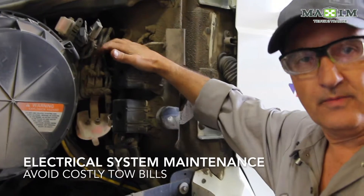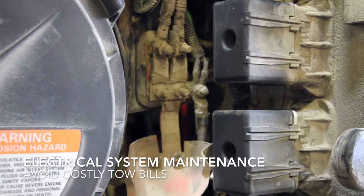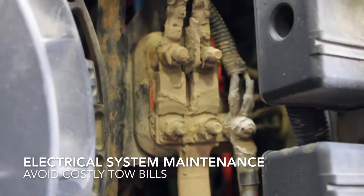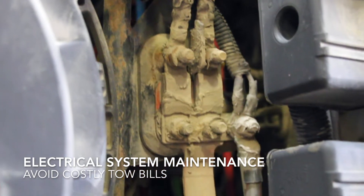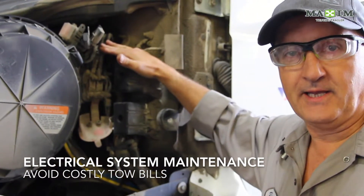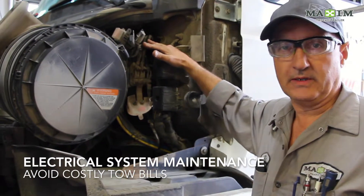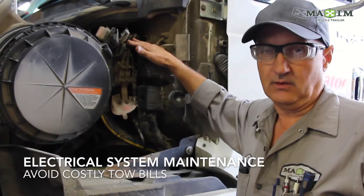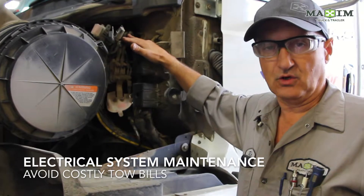Here we've got another example. This is probably okay, but because it's covered in so much dirt, you're not going to see corrosion taking place beneath these. These are actually two 150-amp fuses that protect the cab circuits after the battery power has reached this distribution point. If you keep this clean, you can see if corrosion is building up. And if you can see it, it's very easy to take it apart, clean it off, and then reseal it with any good battery sealer. That's good for any of the major electrical connections on your truck.